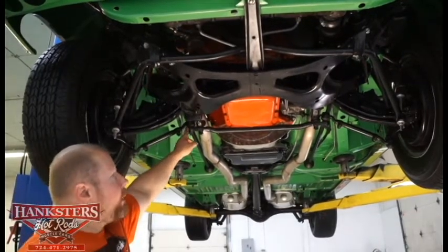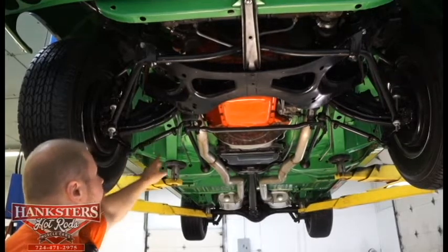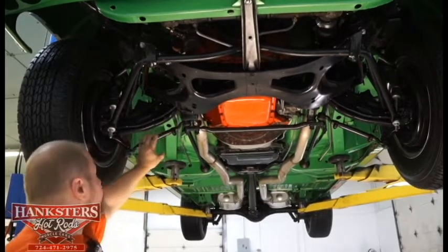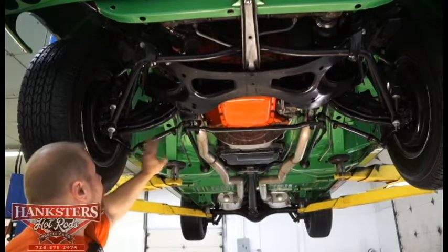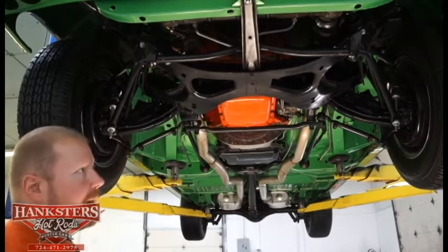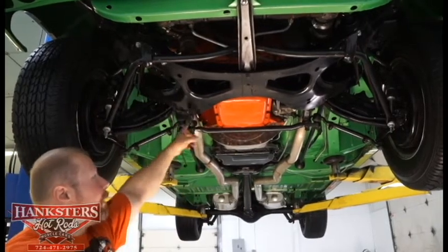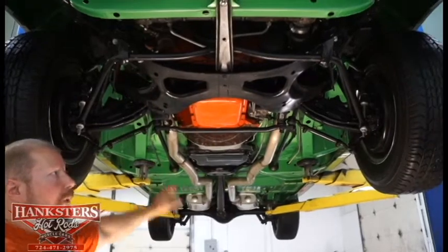They're not split. They look to be all fairly new, maintained very well. Grease fittings, you can tell they've been greased and cleaned off then. Ball joints, those are in excellent condition also. All the boots are intact for those as well. Your drag link, again, pitman arms, those are all in good shape.